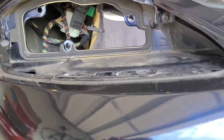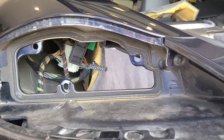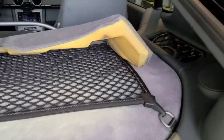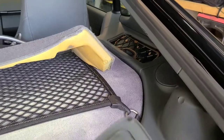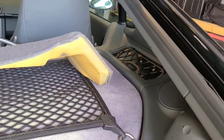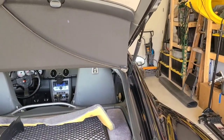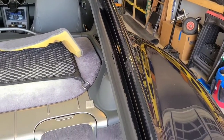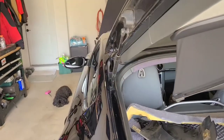Got the tail lights out. You can see that's where the three studs go through from the tail lamp, and that's the electrical connector. Same thing on the other side. While I've got it down, I'm going to replace the cover that came off the rear compartment on the passenger side - got it in my hand right here. The car's an '07 with 136,000 miles, stuff happens. I got those little felt things for the ends of the cargo cover and on the sides to help stop rubbing from these edges.